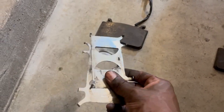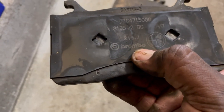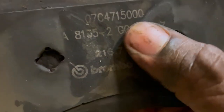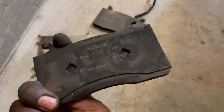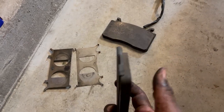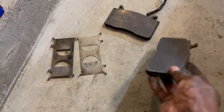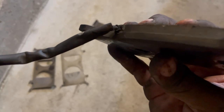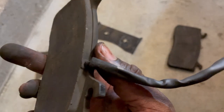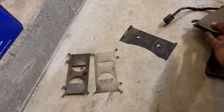So just be careful when taking this caliper off - rest it right back here on the brake rotor until you're ready to remove and replace the brake rotor. Out of the caliper are going to come two shims - I think these are just OEM shims - keep these. And then you've got the Brembo OEM Brembo pads with the alpha shield and the Brembo logo and the OEM number. Hold on to your OEM pads always, even if you go aftermarket. Hold on to these first set of pads because if you ever need to get OEM pads, you can just pull them back out, search the part number and order some. The wear sensor is basically a wire that, once it detects metal of the brake rotor, it completes the circuit and turns on the wear sensor.